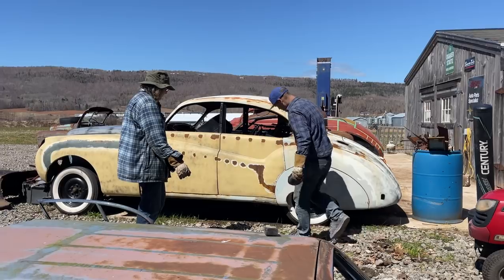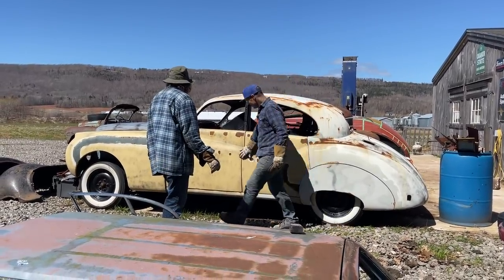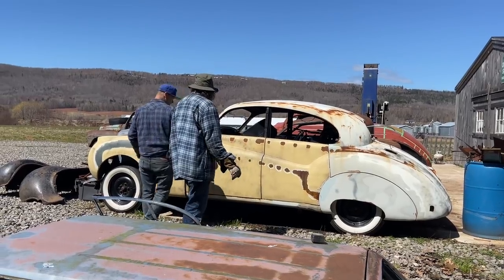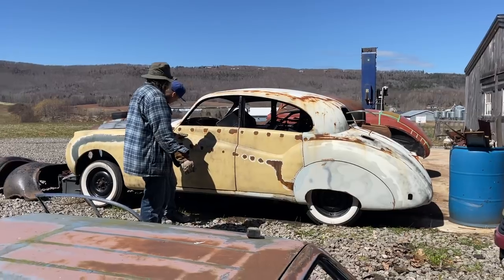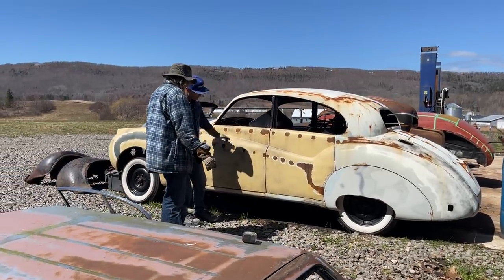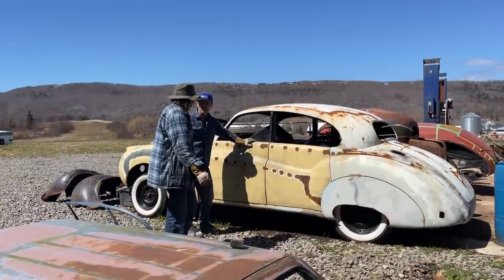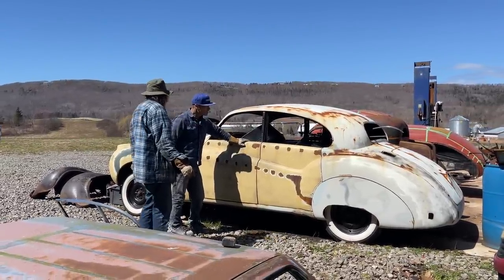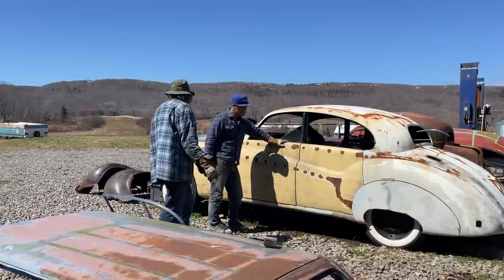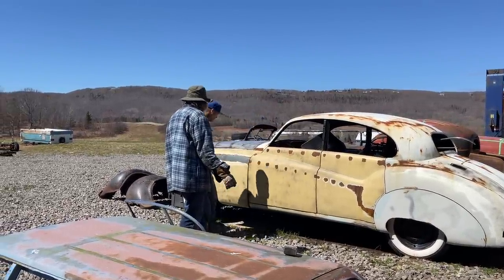They use body filler just like I do. And I'm not going to, it's got a guide coat on, it's got good primer on it. I'm thinking that they probably did all the body work on it. So I'm just going to sandblast it wherever it's like that and then fill it back in. Yep. I'm not going to strip all the other stuff off. No, it's on there good. It'll tell you where you have to strip it off. It sure will. Yep. Or the sandblaster will.